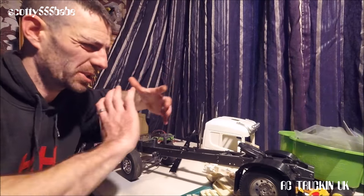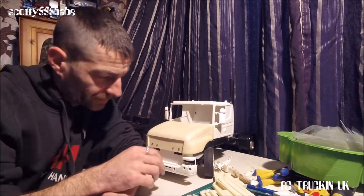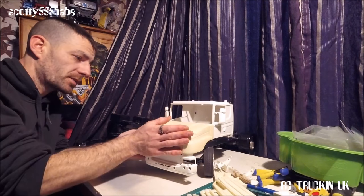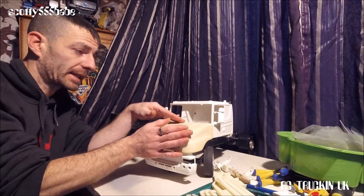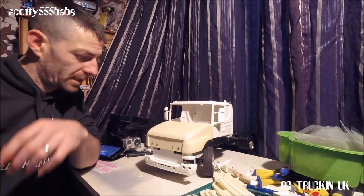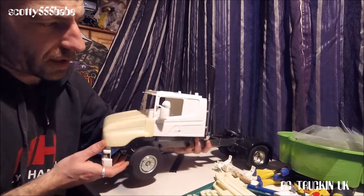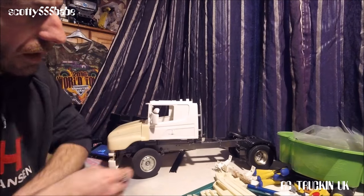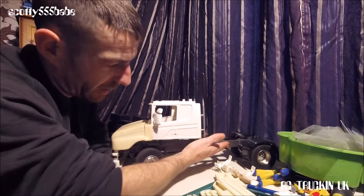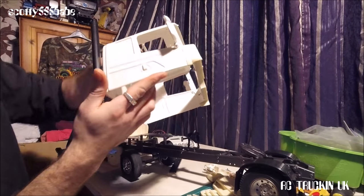You will be left with a gap in the middle where you haven't put any holes - that's different anyway to what the standard Scania rails would have. You'd have to re-drill that section differently depending on your preferences, whether you're having tanks or locker boxes. There will also be people out there who could have things made up for you. You could go with the standard rail but then it all ends up looking a bit squished and it doesn't look right.